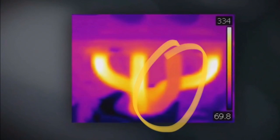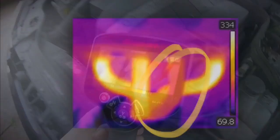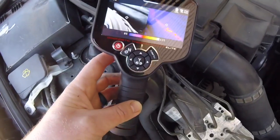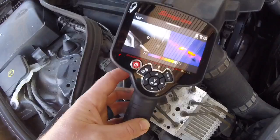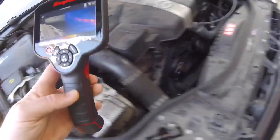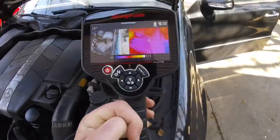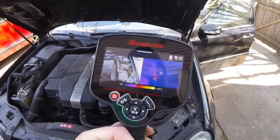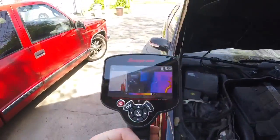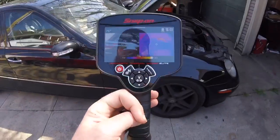What you're seeing glowing through there is the exhaust manifolds. If you have a cool spot in one of those, chances are you have a misfire. That one looks pretty even all the way across. Kind of hard to see on this side because the air box is in the way, but that one looks nice and even. Back to computer controls class, right?